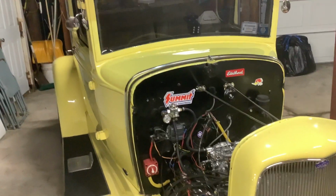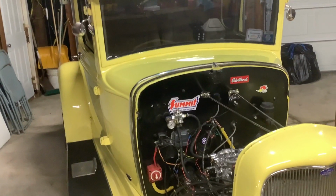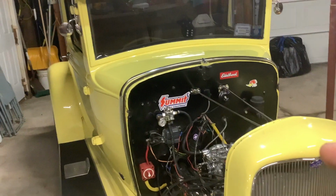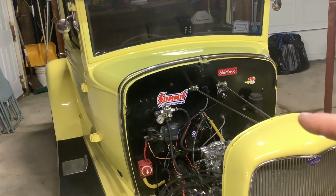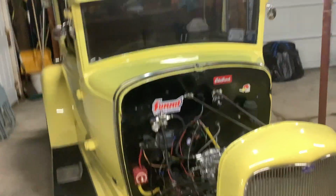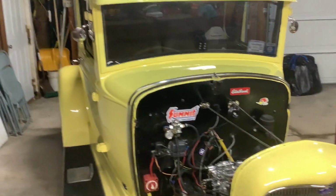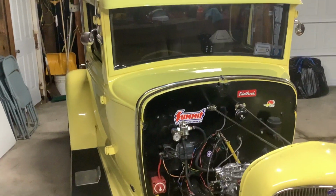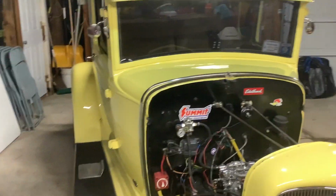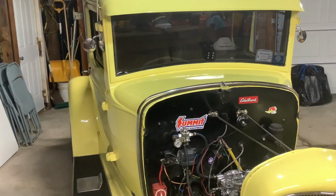But what it does, you drill a hole, it puts a 1/2-inch hole through. It's insulated, it bolts together. It is through the firewall for power. And it's a bulkhead. The power will come up, and then it'll jump over to the starter solenoid relay, and then it'll go inside, and it'll do another little junction, and that'll feed the fuse box. And to the key, power to the key, power to the fuse box, because I'll have things like headlights and 4-way flashers on and brake lights on all the time.